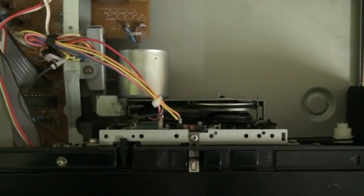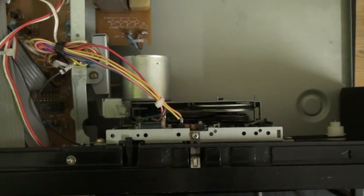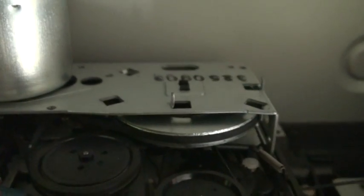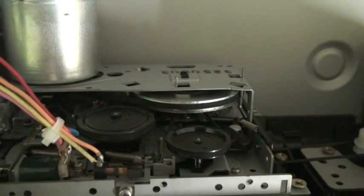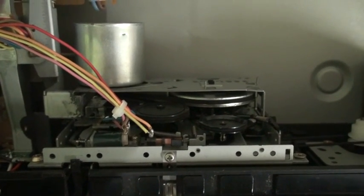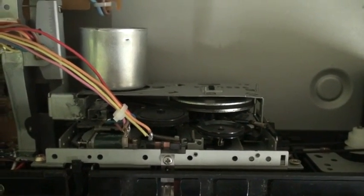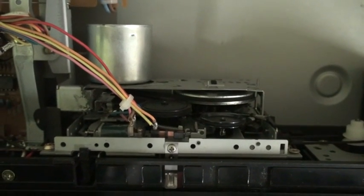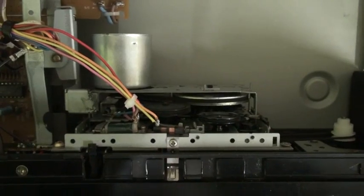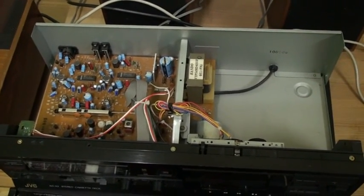Now there we have the mechanism. Good things are it does have a decent-sized motor — it's not one of these ridiculous tiny little things they built into cassette decks in the 90s. And as you can see, it also has quite a bit of a flywheel. It's a joke compared to late 70s — early 70s — cassette decks, but it is quite something compared to 90s cassette decks. In those years they came up with the plastic disc which just had a little bit of metal going on around it instead of a flywheel. This is not too bad. And that's really it — there is not much more going on in this unit.